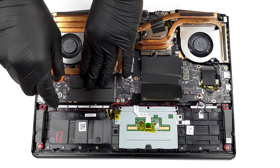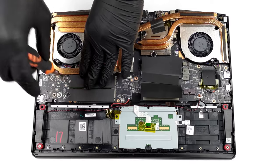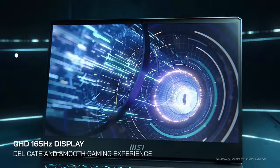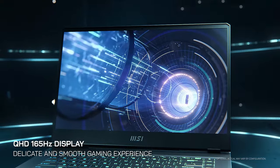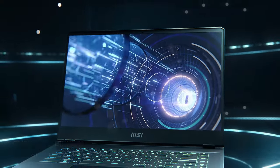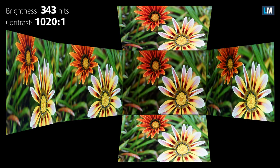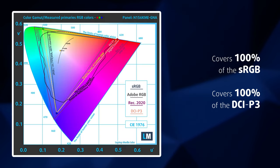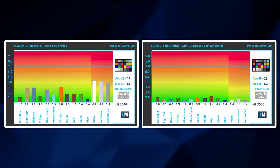You can take a look at our teardown video to see how to open the device. The MSI Vector GP66 in the configuration we tested has a 165Hz QHD IPS panel. It comes with a good contrast ratio, comfortable viewing angles, and super-fast pixel response times. What is more impressive, however, is the fact that it completely covers the DCI-P3 color gamut. This results in a really vibrant and attractive image, and our gaming and web design profile improves the color accuracy so much that the display could be used even for professional work with colors.